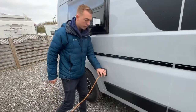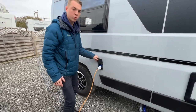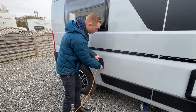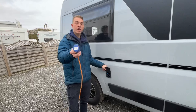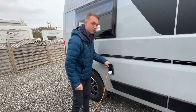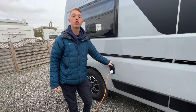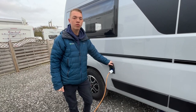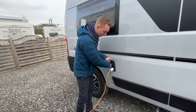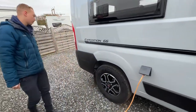To hook the vehicle up, this is your hookup point - a mains 230-volt connection. Whether you're hooking up at home over the winter or on a site, get your hookup lead, lift the collar, slide it onto the van first, then connect to the site or house. Do it in reverse order when unhooking so you're never walking around with a live lead. To release the cable, push the small blue clip in on the left-hand side.